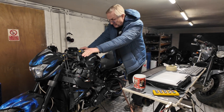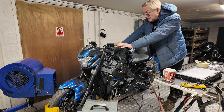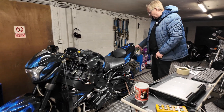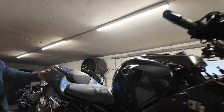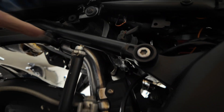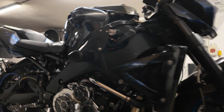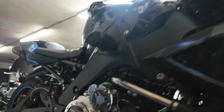Now I'm wading through the bikes — we recently did the Thruxtons, just did the Harley, and now we've got the Bking to set up. Tomorrow morning I'll be firing it up and setting it up. We've put a new exhaust system on it because the previous exhaust was rubbish. We've re-engineered it to fit with his original Two Brothers cans — you can see it comes from there all the way around and up through here. We utilized a couple of the original factory parts and got a nice curve giving some decent horsepower gains.